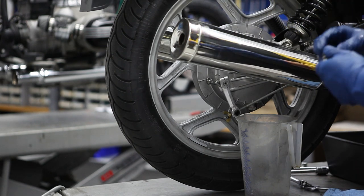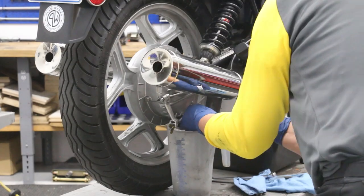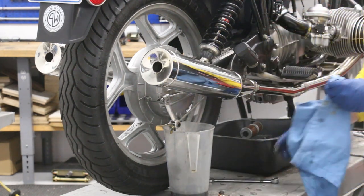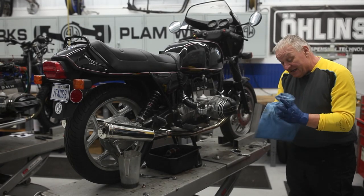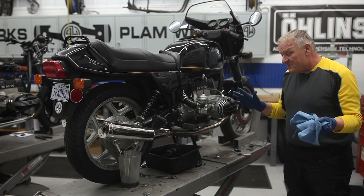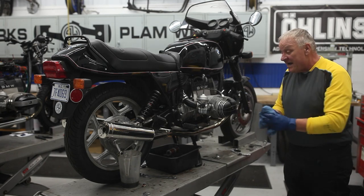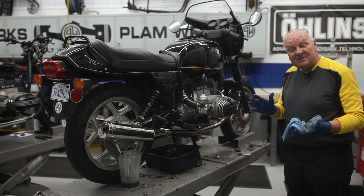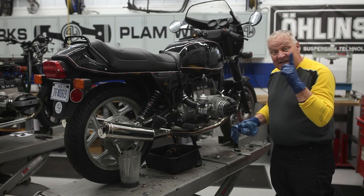Even though it would vent without removing it, you might as well take it off — that way you certainly won't forget to put oil back in there. Now I'm going to get my work clothes on and give the bike a couple of hours to cool down to room temperature so we can go ahead and re-torque the cylinder heads, finally set the valves properly, and refill with fluids. Then this bike's ready to roll.